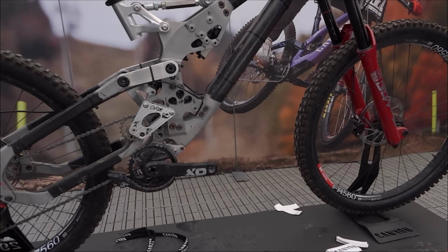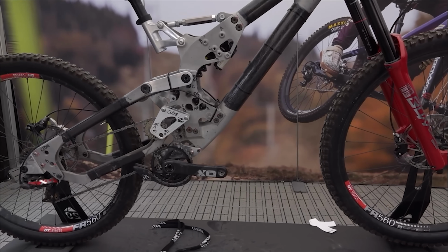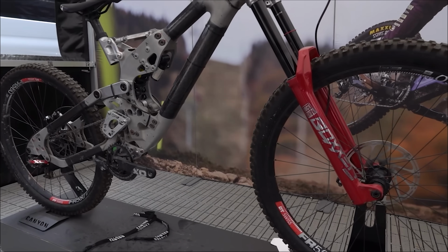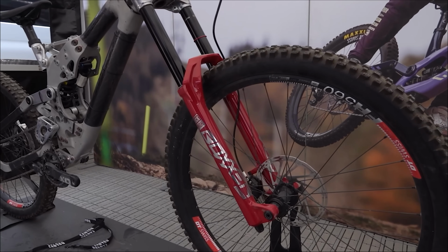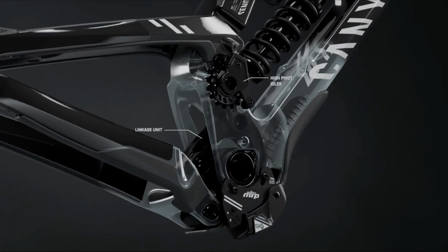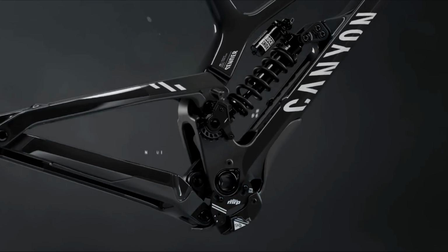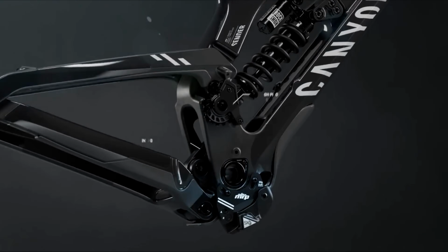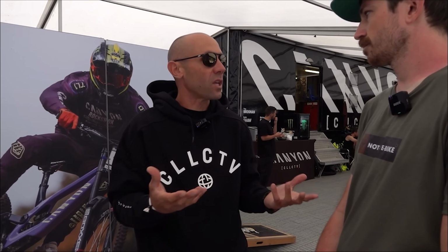Well, I actually have been part of the chart that was in the process of designing this bike, and after that I did more than 200 runs on this bike to do all the different versions that we pre-designed. I really feel that we are at a point in the industry where we have been through many suspension systems, kinematics, and many directions, and a lot of trends have been bringing brands in one direction or another. I felt it was a really important moment to settle our design and try to isolate different things to test, in terms of wheel path, compression ratio, anti-rise, anti-squat, to properly understand what was the best combo we were looking for and what would bring us the ideal situation with the global level of technology we have nowadays. So I was really surprised when the graphs and the numbers came out.